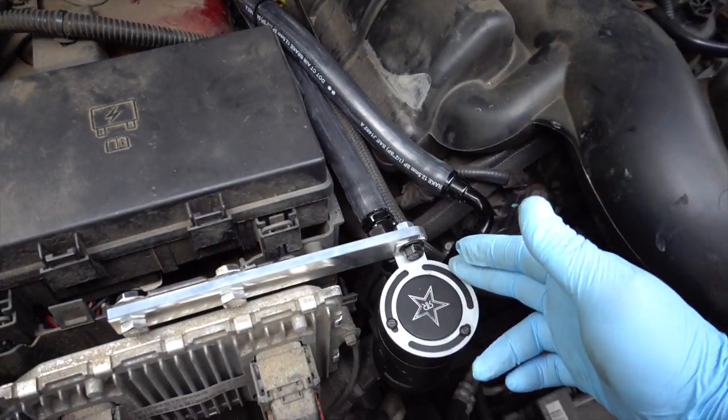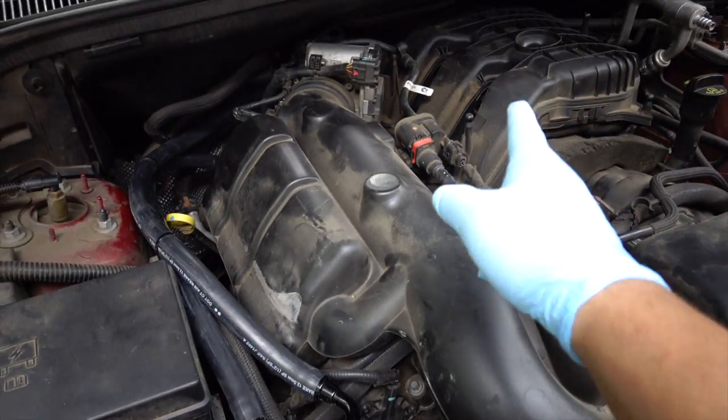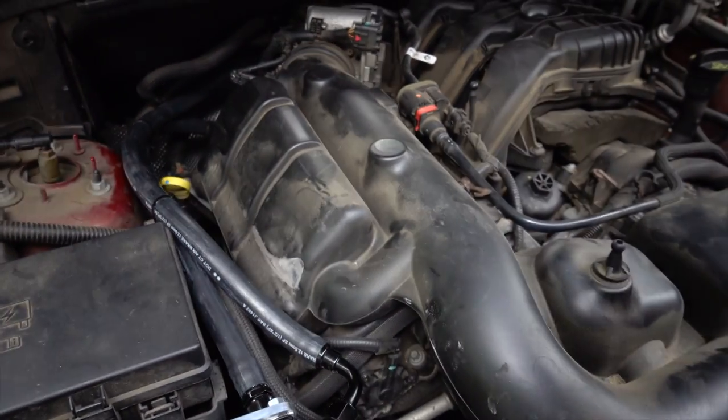No weird noises. Once I start moving, the air and oil will come here, oil will get trapped in the catch can, and clean air will go back into the plenum — so it won't dirty up my valves or runners. I'll try to leave Amazon links to everything in the description. It's a super simple mod with a lot of benefits — I highly recommend it. I have about 1,000 miles since the last oil change, so hopefully in 4,000 miles I'll show you guys what I got from the catch can. If you liked it, smash that like button, subscribe, and hit the bell icon. As always, keep moving forward and stay on the gas.